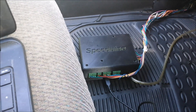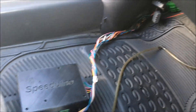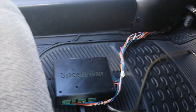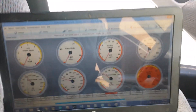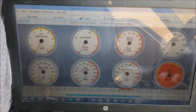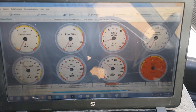It's been about two hours, two and a half — I spent about half of that time looking for tools. But we have the finished product: Speeduino in a box, MAP sensor line, and wiring harness. I'm actually going to be putting the Speeduino box into my glove box for now, it's only temporary. I'm going to be throwing some loom on the harness to make it look a bit neater. When you're done, if you follow the link to the write-up on the forum you'll get a link to download a base map. I also have a video showing you how to upload a base map and get started — check the playlist on this channel. All you need to do is load the base map and start her up.